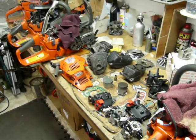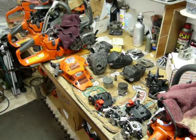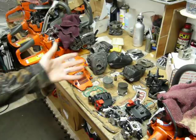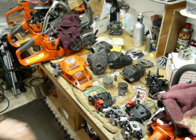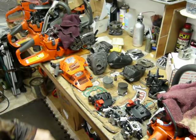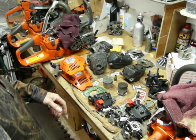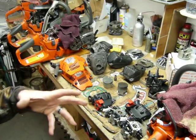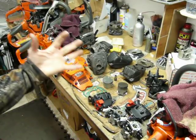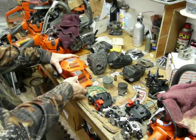We're seeing a lot of the tolerance numbers come in way over 3 thousandths, which on any saws before this style of engine, you're kind of looking at that as a throwaway option, unless you can come up with a piston that's 1.5 thousandths or so bigger in diameter. With these new saws, they come out of the box that way. We'll talk about the piston design a little bit more as we go along, but we kind of segued off into what's actually happening internally. We'll get back on track.